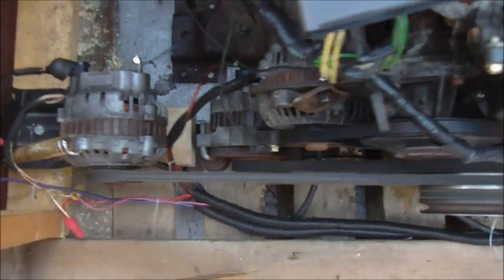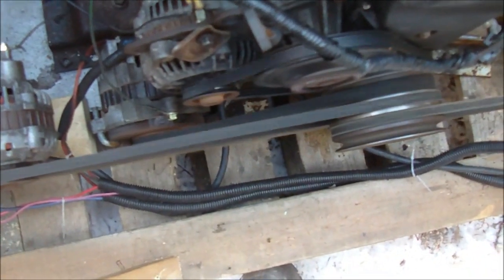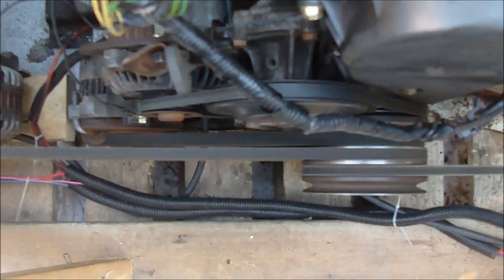It hasn't idled down yet, but let's take a look. What I've done here is attached a few alternators onto the front. This is the original alternator, but I've attached a pulley — I welded this pulley here on the front of the original pulley — so it gave me a few extra belts. I've added this GM alternator, which is about 60 amps. This one here is out of a Mazda and it's a 55 amp alternator.